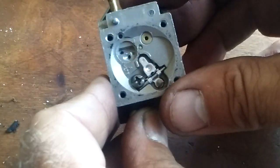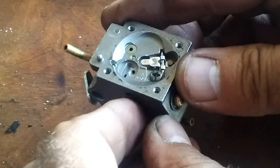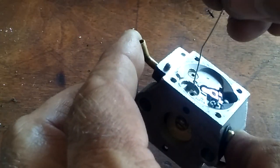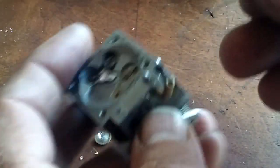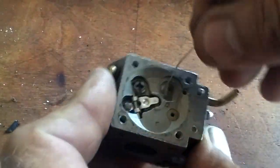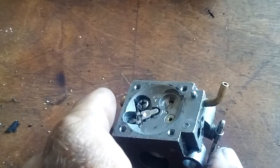So that's how you get it out. See — there are those little holes in there. You can shoot your carb cleaner through there, you can go at it with the little bread twisty tie wire, and you can actually usually, if it's clear enough, that wire will pop right out up inside the throttle body. It's like for one of the idle jets.